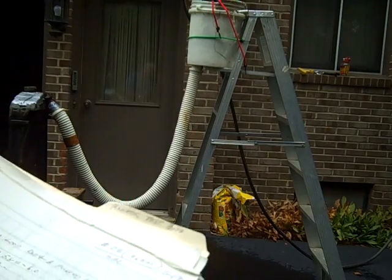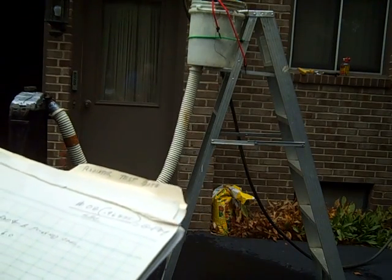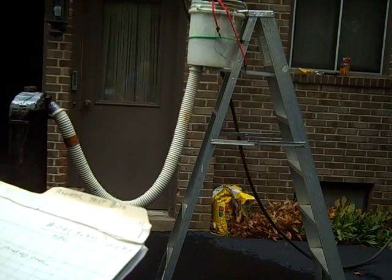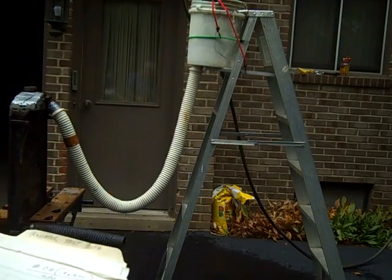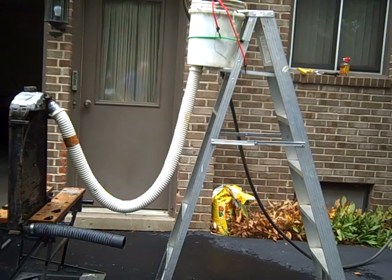So the first time we did it was 26 — I think there was air in the radiator. The next time we did it was 35, then 38, then 40, then 38.35. So we've got a radiator that'll flow somewhere around 38 gallons a minute. Now if we can get those few leaks fixed and get the top soldered on, we've got a mighty fine radiator there.